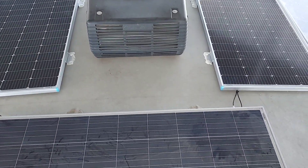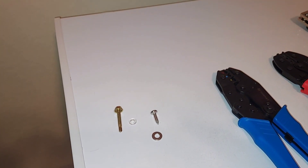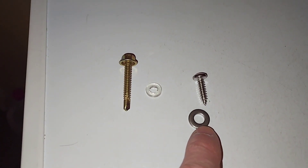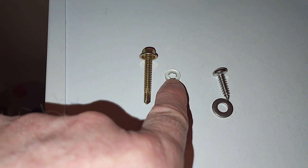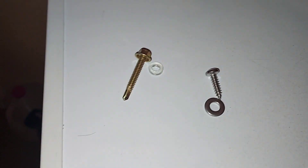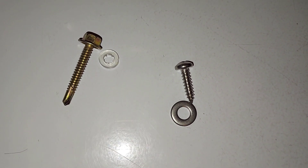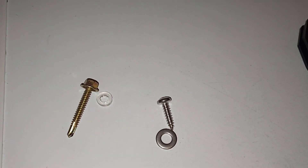To finish this up — I used 3/4" long wood screws, these are a number 10 wood screw with a number 10 stainless steel washer. The bracket kit came with an inch and a half screw and a rubber seal for the bottom, but at the last minute I decided not to use the rubber seal and used the washers instead — I think that's a better fit. It's just a Phillips head number 10 pan head screw. The roof is only 3/8" thick and you could feel it when you drill through, so I think that'll be plenty. Then I sealed it real good.